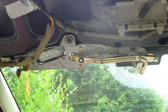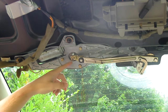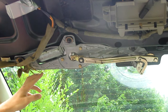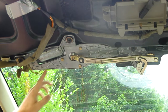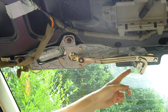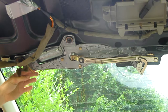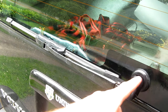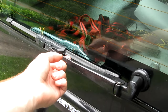If a little bit of lubrication had not brought life back to this wiper assembly, the next thing I would have checked was the motor and its gearbox. I have the wires exposed here, so if needed I could tap in and measure current and voltage. It may require taking off this whole assembly — there's a splined shaft that goes to the wiper on the outside — so this entire frame with the motor can drop out and be unplugged. If taking the motor, gearbox, and linkage off caused it to run at normal speed, that would suggest some issue on the outside, such as excessive friction in the bearings or excessive friction of the wiper on the window.